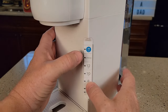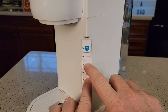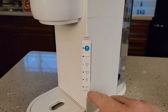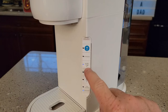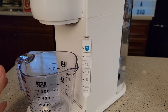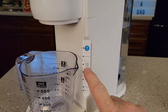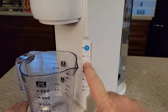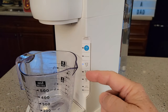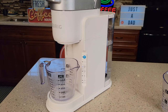We're simply going to hold the 8 and 12-ounce buttons together — make sure you can see the descale light start flashing. Hold those together at the same time. See how the descale light is flashing and the 12-ounce button. Now get your cup ready — it's going to dispense hot water or the descaling solution. To activate it, press the 12-ounce button. It's going to run 12 ounces of solution through the machine. Be careful — it will come out hot.